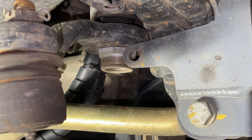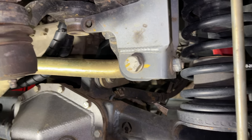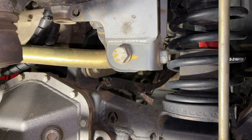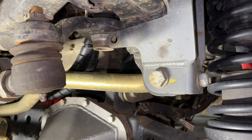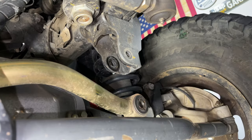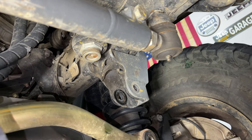The first thing we're going to do is loosen up that old pitman arm nut — that's the 42mm one from Synergy — while the tires are still on the ground. To do that we have to drop the track bar, so we'll pull the track bar bolt, drop it down out of the way, and then loosen up that 42mm. Once that's nice and loose we'll pull the tire on the driver's side so we can get at the steering box bolts. Now that the track bar is dropped down we have free access to the 42mm bolt.